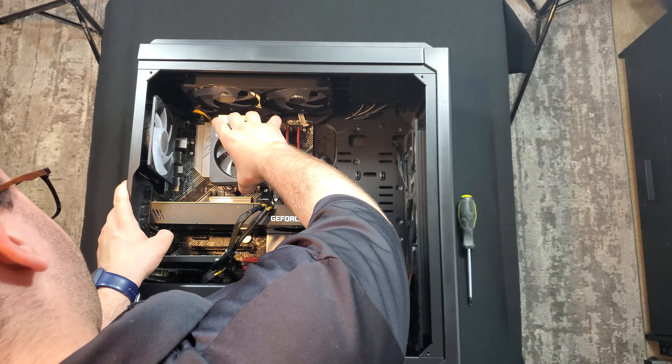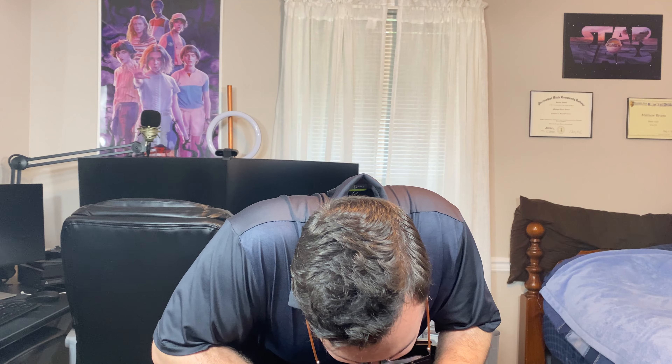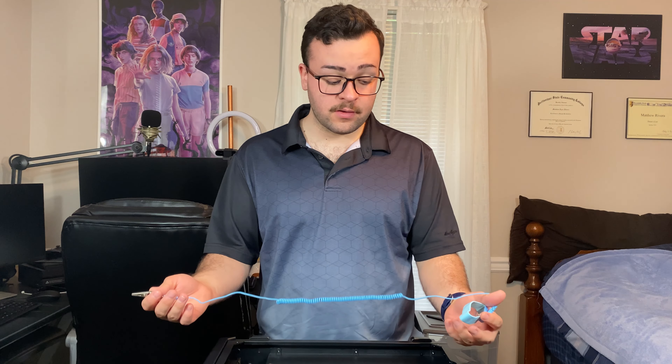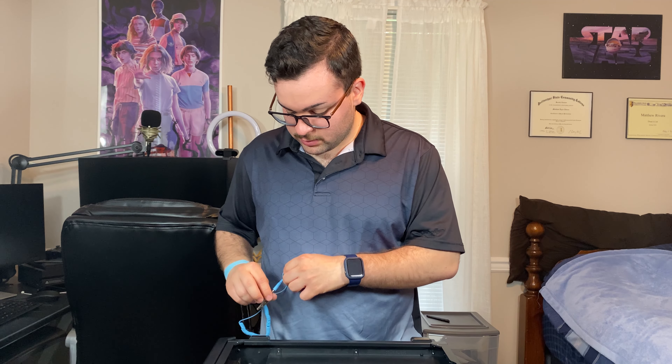It doesn't look like we have to press down — there it goes, it's moving freely. I just have to figure out how to remove it. There it goes — that's one bracket. There it goes — pops right out. It's a really cool mechanism if you really think about it; really sturdy too. This is a grounding strap. All you do is place it on your wrist and attach it anywhere on the chassis — you're grounded to the chassis. Since we're dealing with the CPU and motherboard area, you don't want to get a shock. Especially when you're on a rug — zap, you're done. We're going to now take these brackets out, which we'll unscrew with a Phillips head.